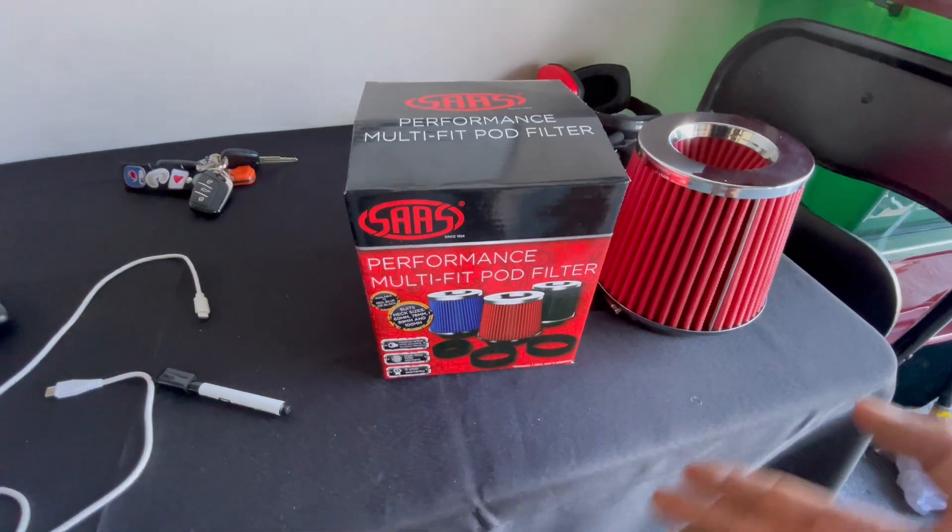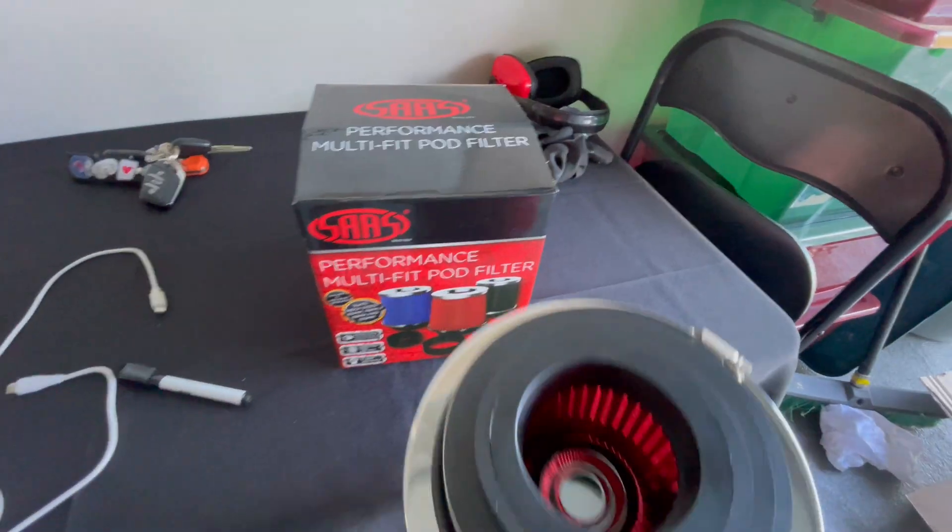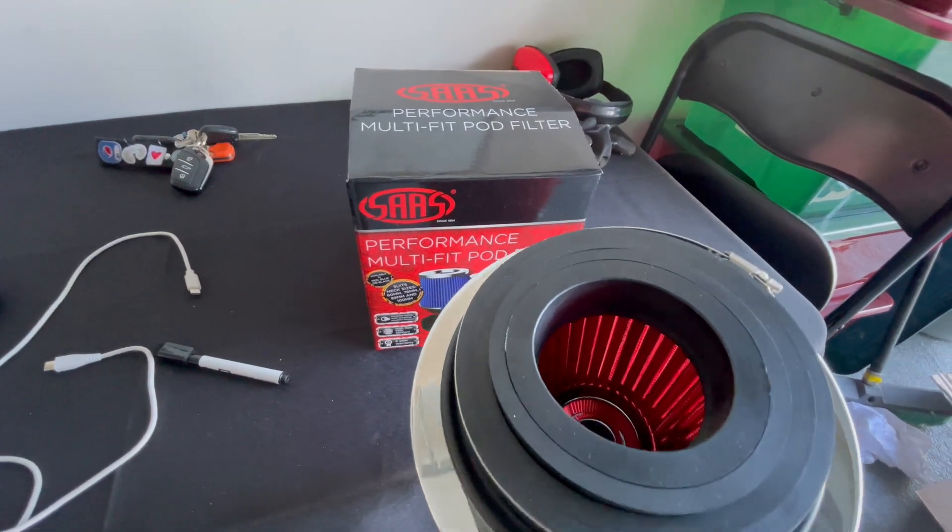This is my air filter of choice — it's 25 bucks, cheap and nasty, and it comes with ring adapters which will allow me to put on the two-and-a-half inch pipe. The intake on the turbo is 76 mil, which is pretty much three inch, but we don't have room for that — we barely have room for the air filter. No point babbling, I'm just going to get in there and try to do it.